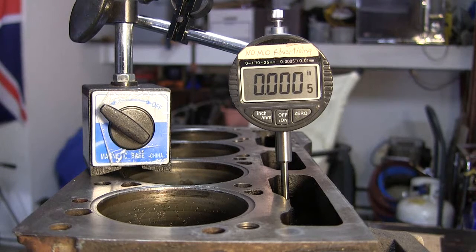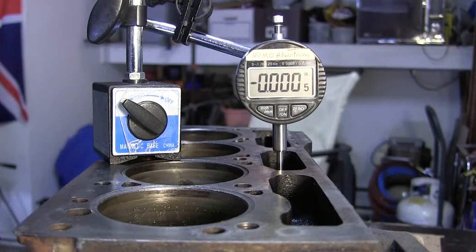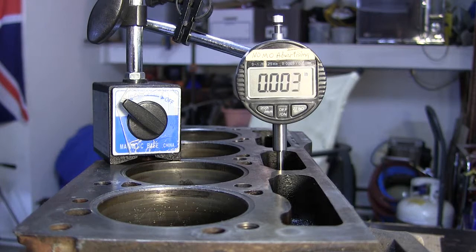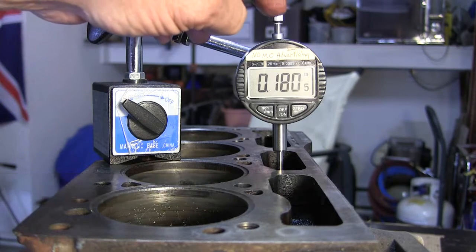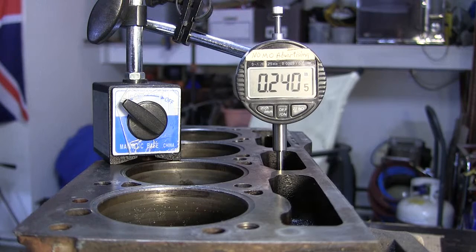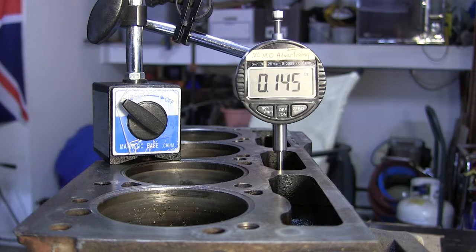Let's see — a big difference between the first and second cylinder intake. Number two exhaust cam lobe: coming up — 242. 236, 237, 239, 240, 241, 242 coming up, 239, 240, 241, 242. Readings around 0.240–0.243.